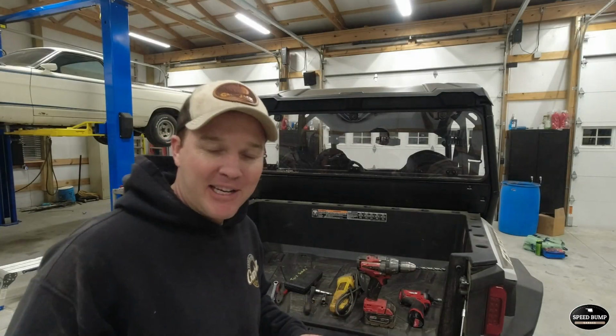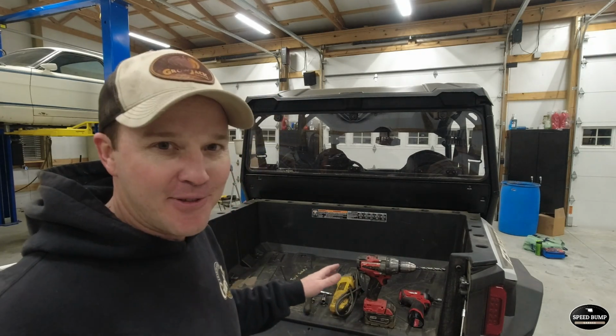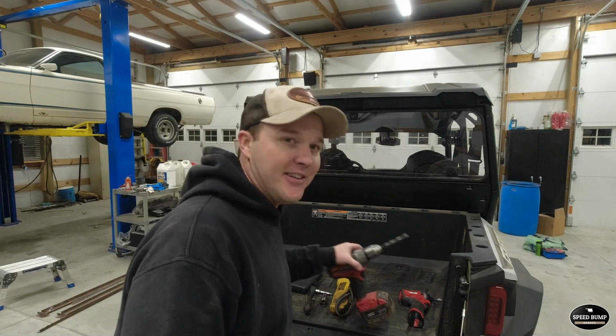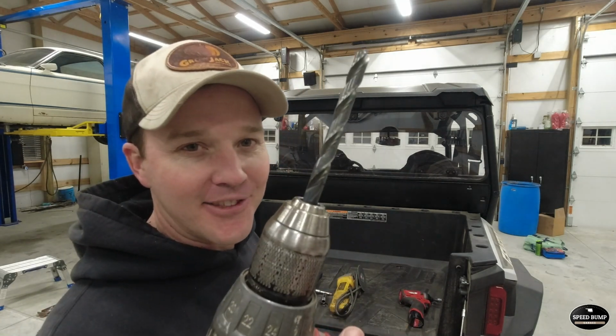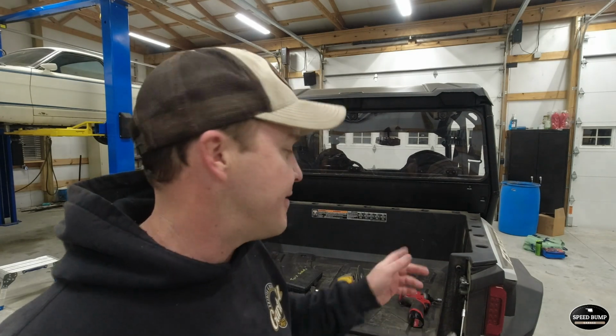All right, guys, I'm coming at you from after the video, but I want to break in and tell you all the tools I used for this installation. You're going to need a drill and a 3/8 bit. You want a nice sharp bit because you're drilling 6 holes through the frame if you have a 4-seater.